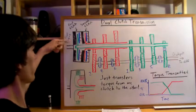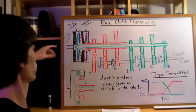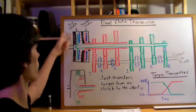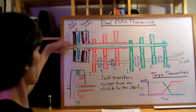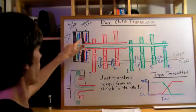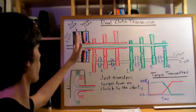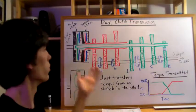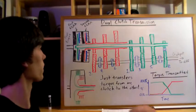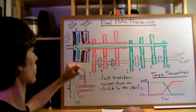You're going to have a clutch housing that's rotating from the engine. The engine has a crankshaft connected to this rotating clutch housing. Everything in black is rotating with the engine, as well as these blue plates. These blue plates act like pressure plates, and for this example I'm going to be using two single-plate clutches with friction on each side.